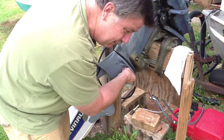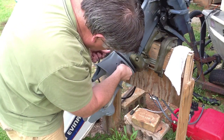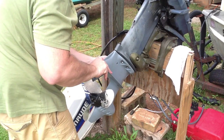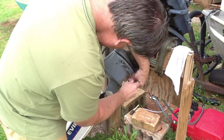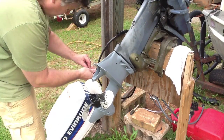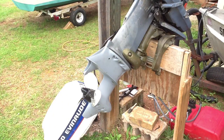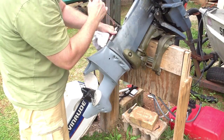I still had like a 1/2-inch gap yesterday when I was trying to see how the fit was, and I realized there was a little more up in the crankshaft to clean out. That's why I did that blowgun method. Get all these bolts started. Exciting day. Got that lower unit on. Let's tighten up this one last bolt, connecting bolt on top.